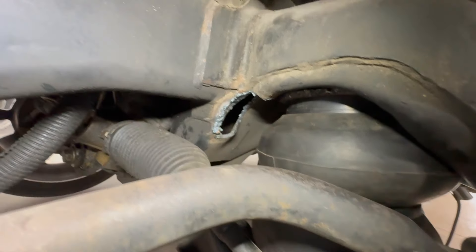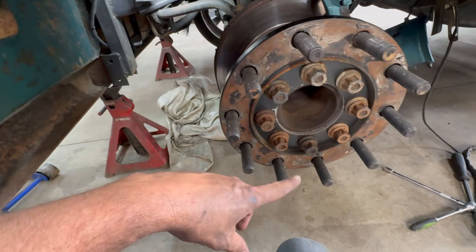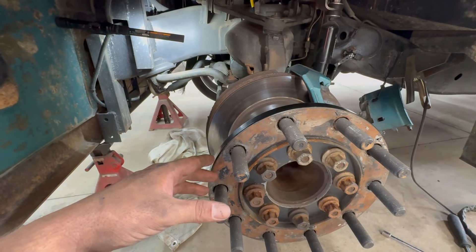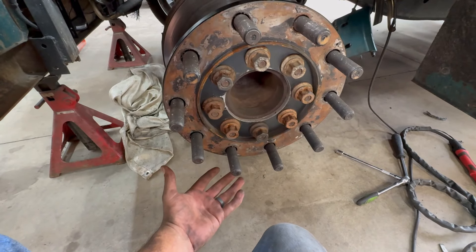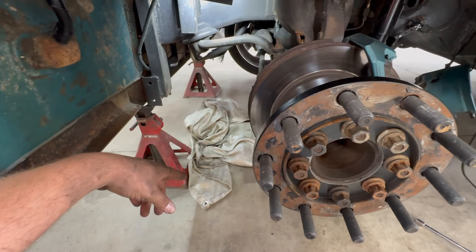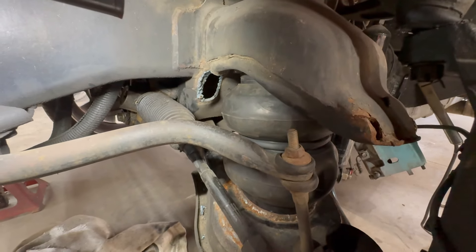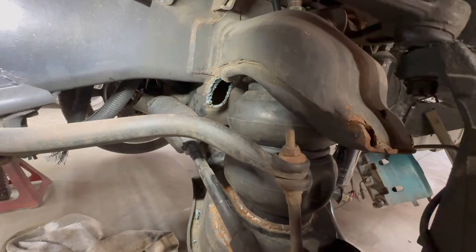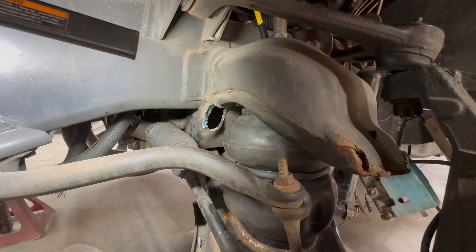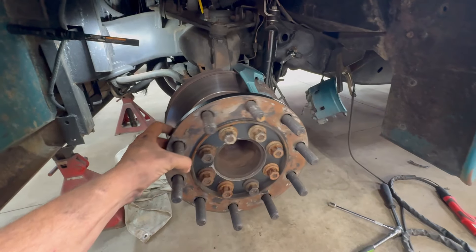The bag board's back in there — I got a nice little bit cut out. What I'm going to do is throw the wheel back on and try to leave it on jack stands so I can still get under it to see what's going on. I'm thinking if I stack up some blocks so the wheel has something to push the tire up against, I can still scoot underneath and check things. I just want to make sure it's not going to touch anything. I've still got the old bag in there just to mock stuff up. I'm going to clean up that cut — I may even weld a little patch in it, I haven't decided yet. I think we've got it clearanced good, so let's get the wheel back on and see what we've got.